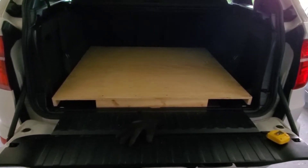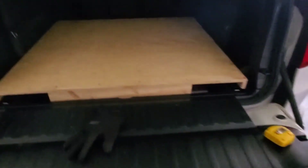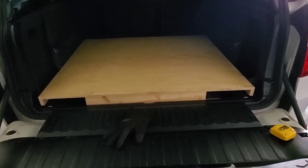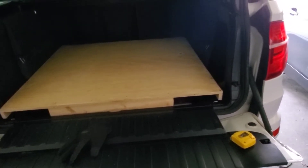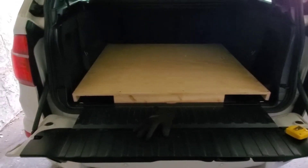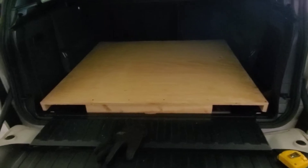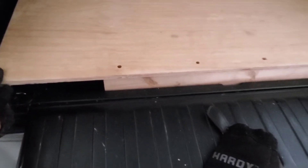I put in a little bit of side support, more towards the back, making them a little bit longer. You could add more support right here if you want, but honestly it's not going to go anywhere and I don't plan on putting anything really heavy on the corner. The measurements: the center support is one and a half inches high by three feet long and one inch thick — just right from the very front to almost towards the back. Three feet is about perfect.